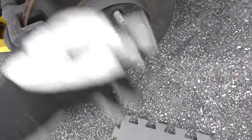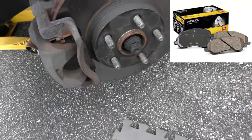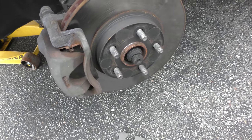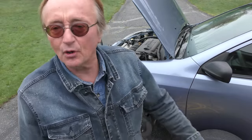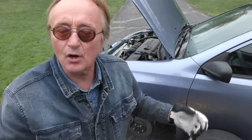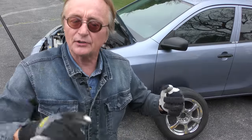These don't squeak at all because I use Akebono pads — they don't make any noise at all. If your car squeaks and drives you nuts, you could replace your brake pads with Akebono (A-K-E-B-O-N-O), the Japanese-made pads, and they won't make noise. Akebono ceramics are extremely quiet. If you don't care about noise, you can go to AutoZone and buy their cheapest pads — they're often harder and actually last longer, but they make a lot of noise. If you don't care about noise and turn the radio up, the $19 pads at AutoZone work perfectly fine.